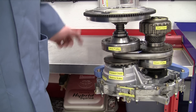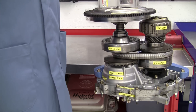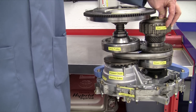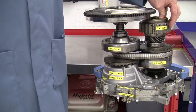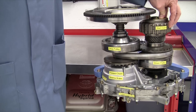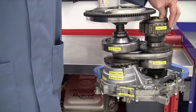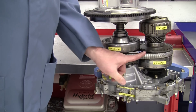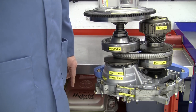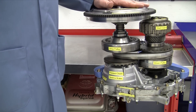This has been a pretty good transmission transaxle over the years, though it has had a few problems. There was an updated start clutch for jerking and shuddering noises as you're accelerating, or cases where the vehicle wouldn't move at all, or would kill the engine when going into gear. They've also had a few issues with failed drive belts, but overall it's been a good transaxle and is still used today.